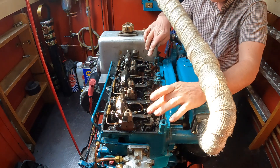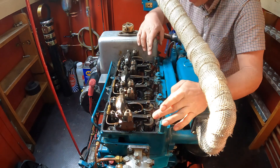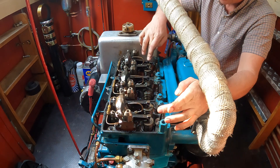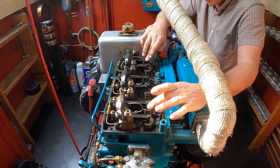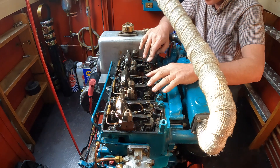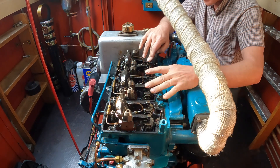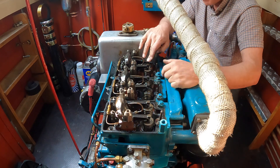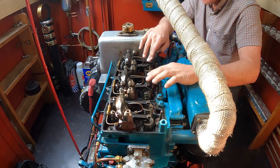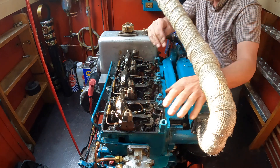So you look for a valve open on each cylinder. The exhaust valve on number three and the inlet valve on number one are open, and the middle cylinder — they're both closed. So that's on its compression stroke — both valves are shut and sealed, piston's coming up and it's compressing. So we need them in the middle, on the rock as they call it. That's how we adjust them.